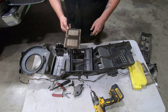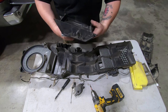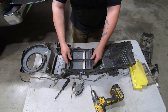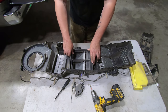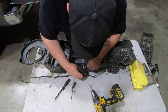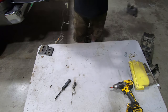Now we install our replacement door, which has a larger end on one side to account for that dummy plug. We slide it right in, install the arm with the provision for the control rod to the other door, and snap it back down. Before putting the actuator on, we confirm the door moves freely — it does. We put the actuator back on and move to the other half of the box to do the remaining two doors.